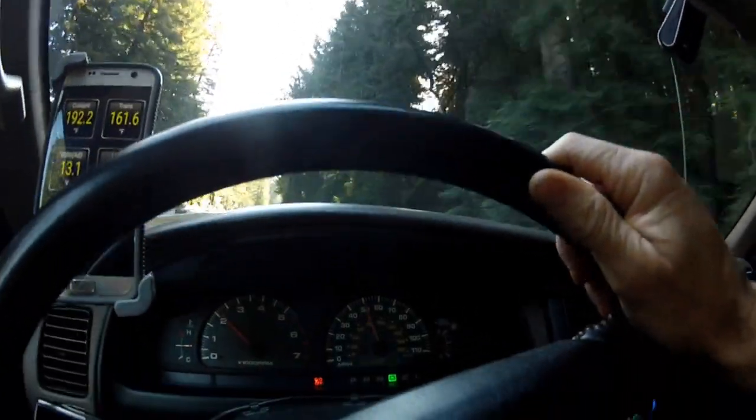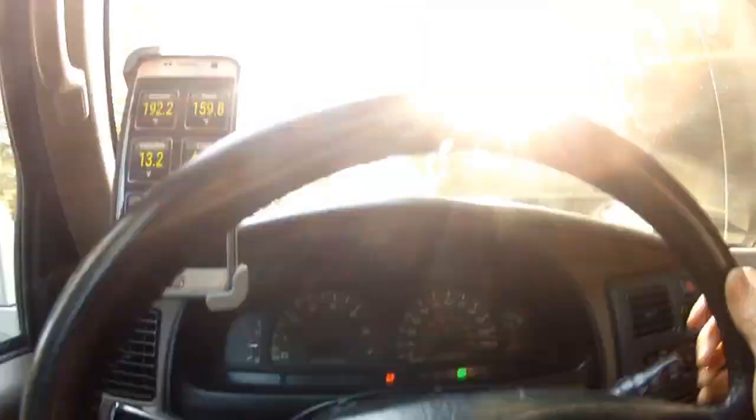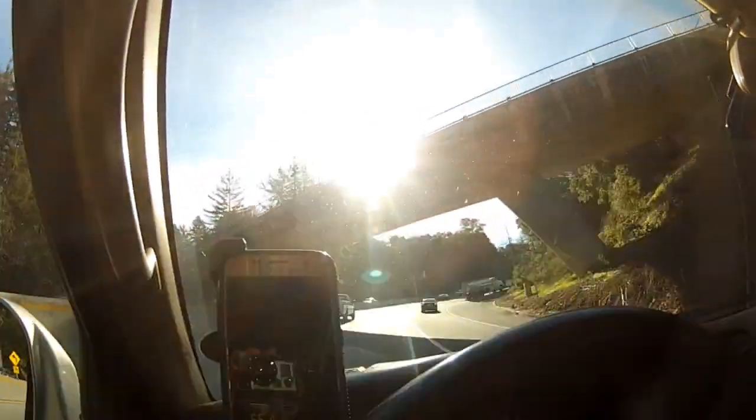I'm at that sweet spot between the gears — I'm at 50 miles an hour, and the RPMs are up because it's sticking in third gear. I ran out of hill, so I can't show you anymore unless I go back down the mountain. But I think I've effectively shown you how turning off overdrive will lower your transmission temperatures when you're right in between third gear and overdrive.